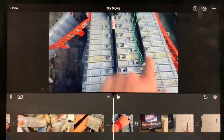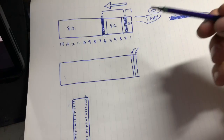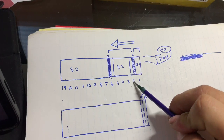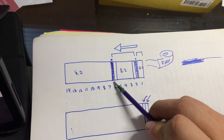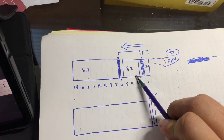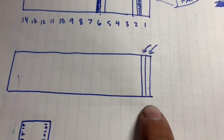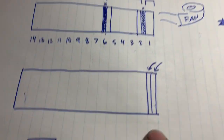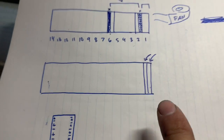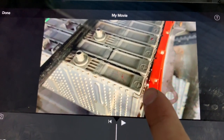Quick clarification: while editing I realized I didn't fully explain how I put the battery back together, so here's a quick diagram. From the fan, the battery blocks are numbered one through fourteen. We removed one cell from block two and one from block six. The remaining cells were maintaining 8.2 volts, so we shifted all of those down and put the new replacement cells into cell block one — that way, if there are any issues with the new cells, you only need to unscrew back to block one rather than all the way to block six or seven.